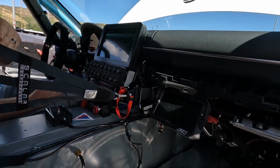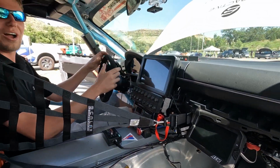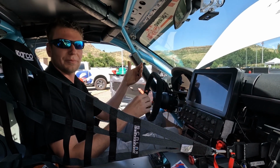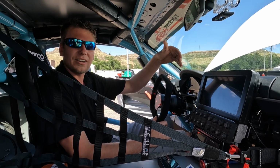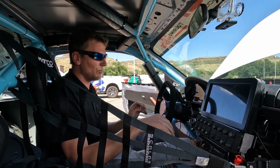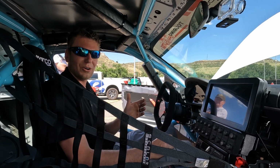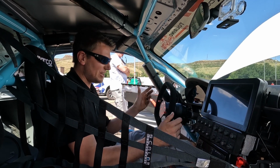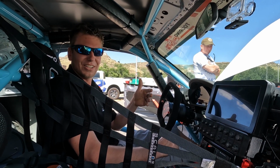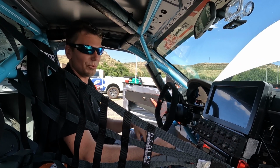As the car is driving around the track, because it has a Cradlepoint in it and it's connected to the internet, I can be driving and radio in that the car is exhibiting some sort of symptom, and I can't see maybe the specific diagnostic data, but I can have somebody in the pits log in, make the adjustment, boom, car's back out again. As far as a prototype goes, that's amazing for us, with our driver out driving it, and we need to make live adjustments to the car. So again, the car is always connected to the cloud. Every second of its life, we know what's going on with it.